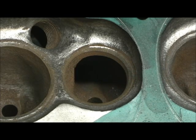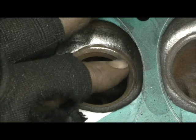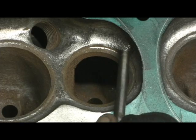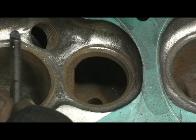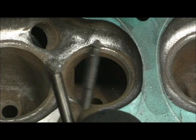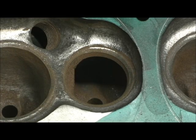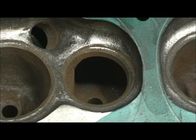Some of them will take a 30-degree machine with a radius cutter and try to clip it to unshroud it, but then you've got this big bulk of material right after the 30-degree cutter unshrouds. CNC chambers — yeah, they're great if they've done it right. It's a hell of a machine, but usually you're hand grinding and pulling this down. Nothing's going to beat it if you're using the right tooling. I'll finish this with the valve out of the head.